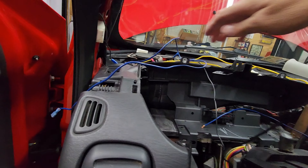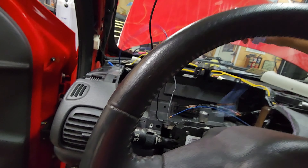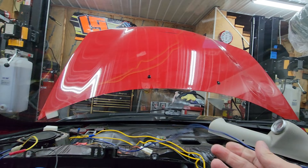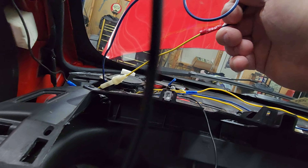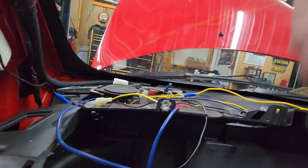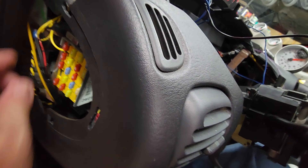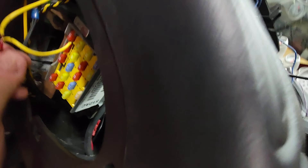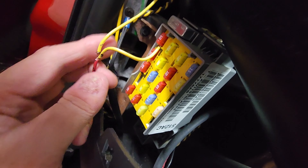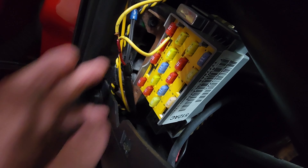It gets even better. Here's the power for the gauges — I traced it back. There you follow it, it comes back around, and I'm pulling on it and — look — there's another crimp, different color. What I don't understand is there's a fuse — an inline fuse — but it's also going to a fuse in the fuse box. They pulled the fuse itself, just pressed it in, and put the fuse on top. But then you find this kind of nonsense wrapped in just barely a bit of electrical tape. Why would you fuse it here and then turn around and put an inline fuse in? I'm going to correct all that.